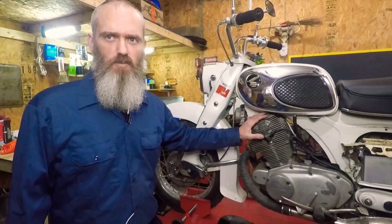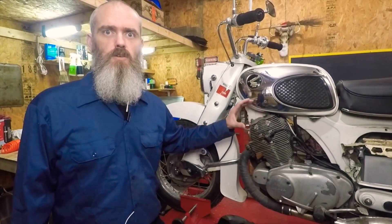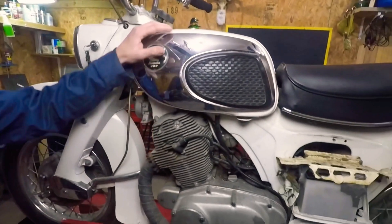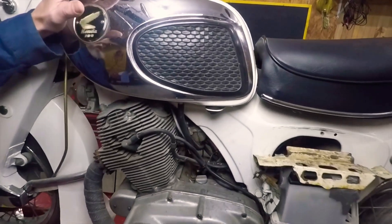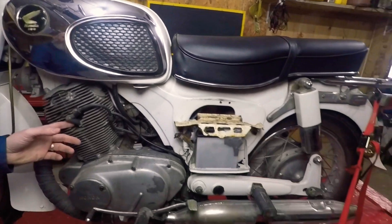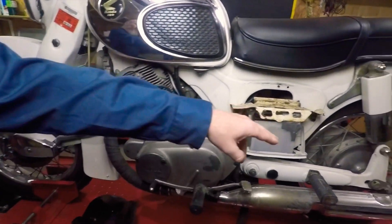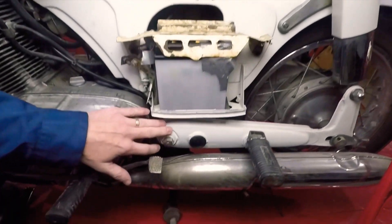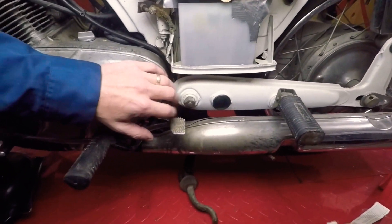We've been having a little bit of ignition breakdown when we were riding last. I want to put a new set of points in it, a new condenser. I got some replacement coils already, new spark plugs of course, and new wheel bearings. I don't know if it has bearings or bushings in the swing arm — we'll address that, make sure that's all up to date.